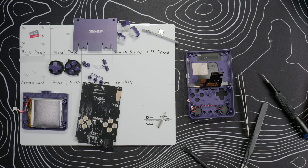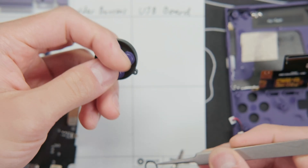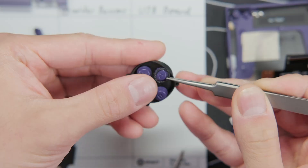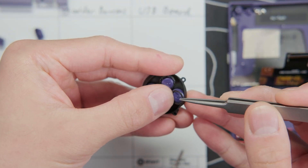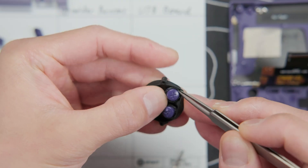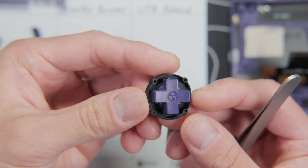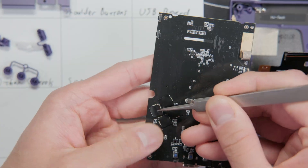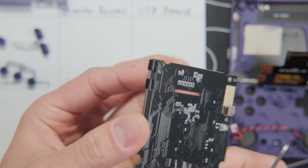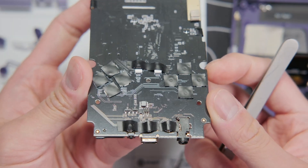For the ABXY buttons I use 0.4 millimeter thick TPU rings. If you haven't seen these before, I highly recommend checking out my silent button mods video, which I'll link in the description — I go over what these rings are and how I made them, and I also publish the 3D files to GitHub if you want to print them yourself. If you don't have a printer, I also sell them on my Etsy shop. I didn't make a ring for the D-pad because it's not clacky. For the rest of the mods, I just put one layer of electrical tape on every other micro switch on the motherboard. For the side switches, I cut a longer strip so I can wrap them around the board so they won't come loose once we put it back together.